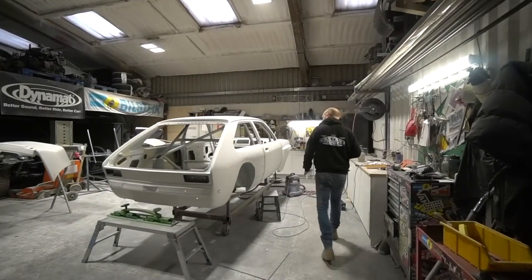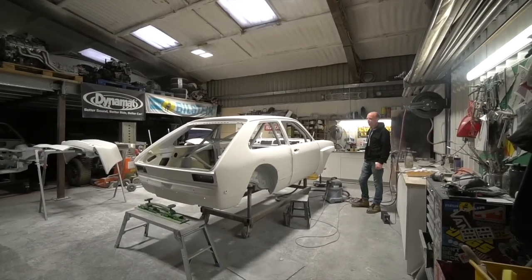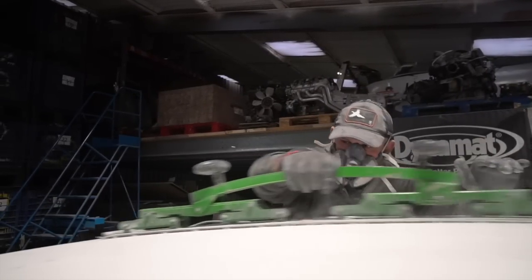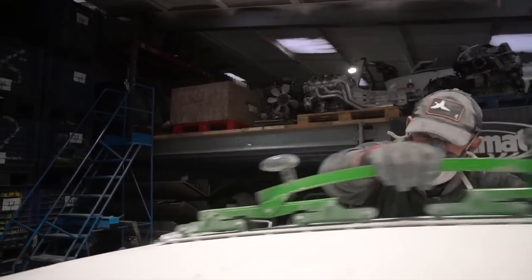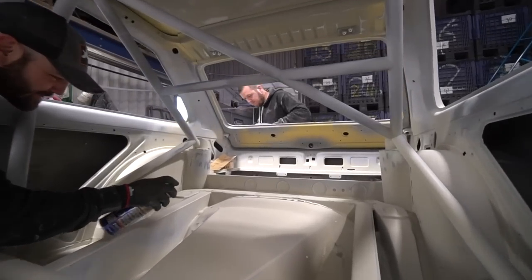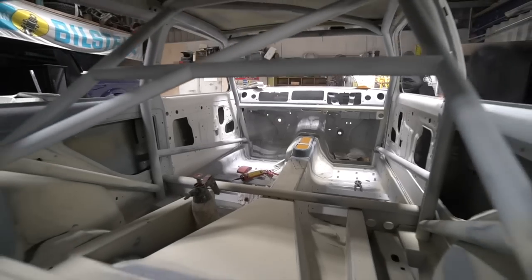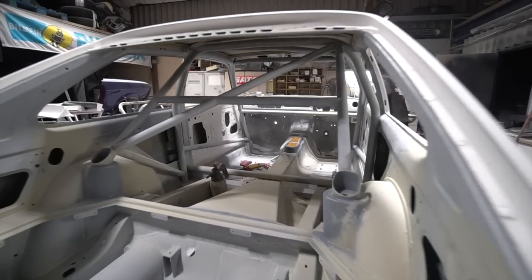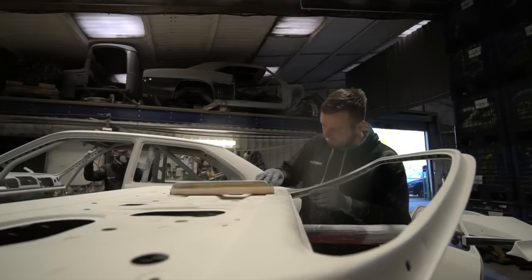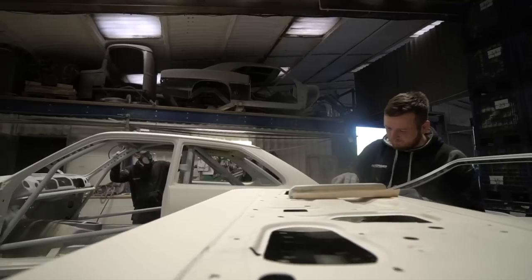To the Chevette, which is in polyester, which I think it was in polyester last week, with the blocking going well on that. Most of that is now shaped. The bulk of it's getting very, very close. It is literally more sanding, unfortunately, and getting gaps right. Most of the gaps are pretty good now. Gaz and Steve have been working on the inside, just tidying up any last little bits of weld that weren't quite tidy, putting some build primer in places on the inside, getting all that prepped and ready for the inside paint, and seam sealing on the inside.